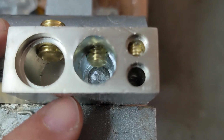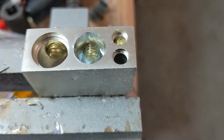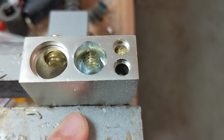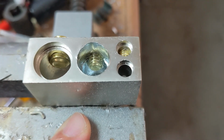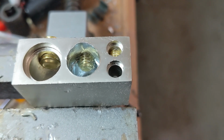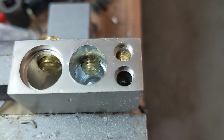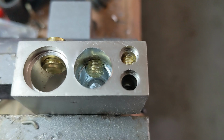So now that I use this as the guinea pig, I'm going to go ahead and take the positive cable off and do the same thing to it. And you might be wondering, why don't I use this one? Well, the bore size on the clamp actually is different between a positive and a negative battery terminal. Believe it or not, it might be a little known fact, but from my research, apparently it's true, although I haven't thrown a caliper on it, so I don't actually have one handy right now. But anyhow, I'm going to bore that one out and see if I can use that. If that doesn't turn out going in the direction that I hoped and doesn't work well, then I'm pretty much back to square one and ordering a new terminal. So we'll see. Anyway, okay, and on to my final thoughts.